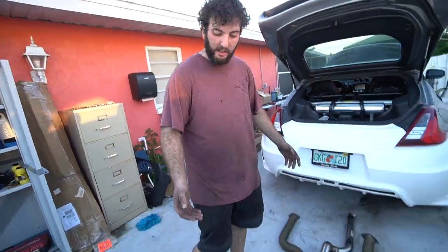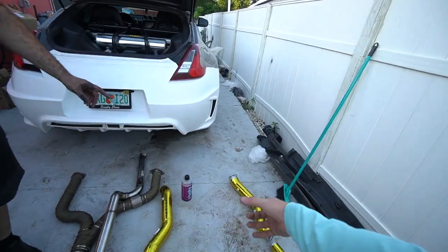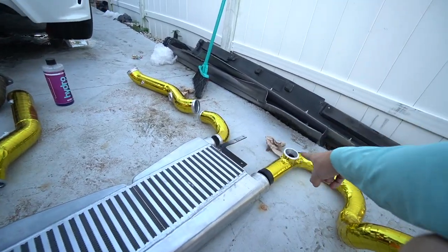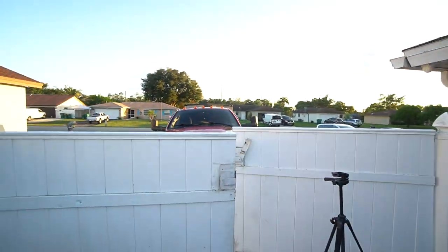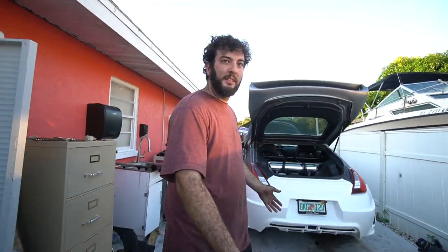The bare pipe is the cold side. This pipe goes right over the exhaust, actually right in front of it. It starts from the throttle bodies — that's your methanol bungs right there. It goes through the intercooler, out through the right side of the car, then connects to the front pipe and goes straight back to the turbo. People talk about slow spool times, but the Borg Warner turbo is inherently designed for diesel trucks, which run cooler exhaust temps. Diesels are designed to spool quickly with lower exhaust heat. Exhaust temp and flow is what makes a turbo spool — it's not just air, it's also heat. That's another reason we wrap all the piping: to keep the heat in the pipe until it gets to the turbo.